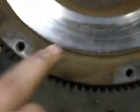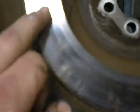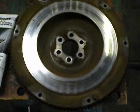The flywheel's not too bad — a few heat fractures, but a good resurfacing will bring this up nice. And the starter motor's just a little chewed, so I'll put a new one of those in. There it is.